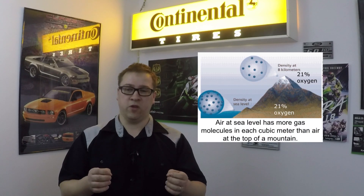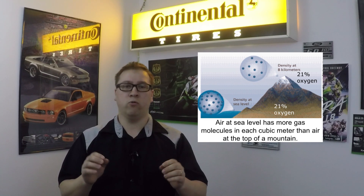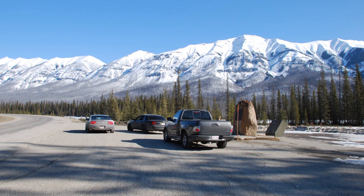So what happens when we're driving and we go back into open loop mode — effectively cold start mode? Fueling becomes less precise. Generally you run rich. You'll experience higher rates of fuel consumption, and your part-throttle drivability will generally suffer. I've noticed this myself: I have a 2003 SVT Lightning that had a 180-degree thermostat installed, and during the cold winter months it would occasionally trip a code indicating it had gone back into open loop. Fuel economy was terrible — about a 30 or 40% loss just cruising around — along with an annoying check engine light.